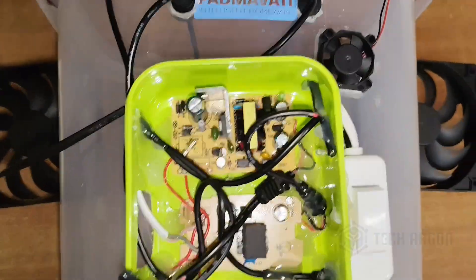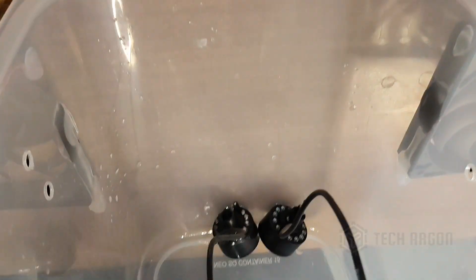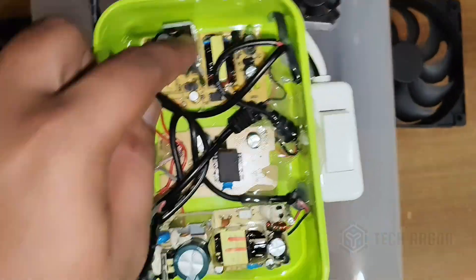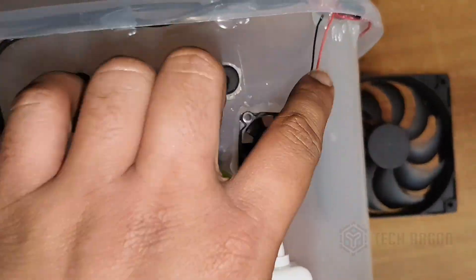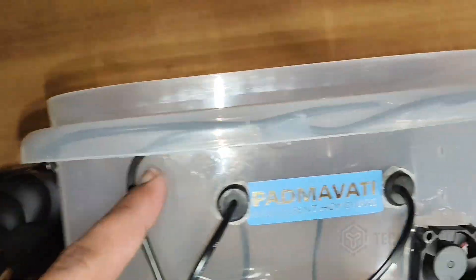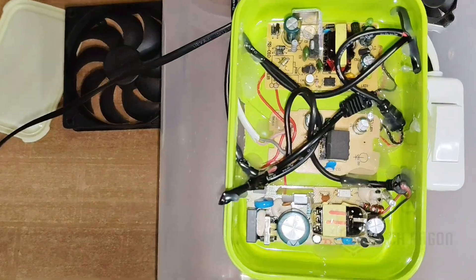You can see the whole connection is done. One humidifier connection goes like this connecting to the first humidifier, and the other one goes like this connecting to the second humidifier. This is the 12 volt 2 ampere, and these two are 24 volt 1 ampere — the 12 volt 2 ampere will be powering our fans. There are three fans, and all three are powered from the same 12 volt 2 ampere supply, which is enough to power all three.